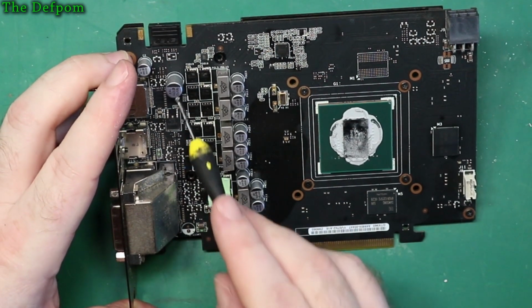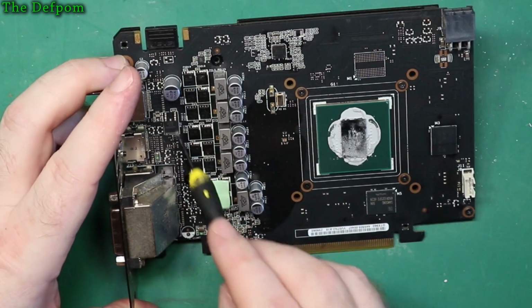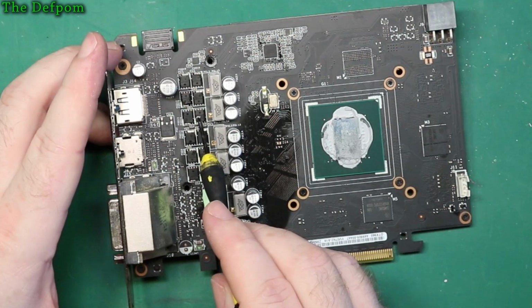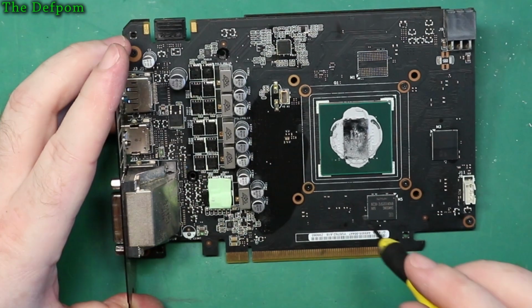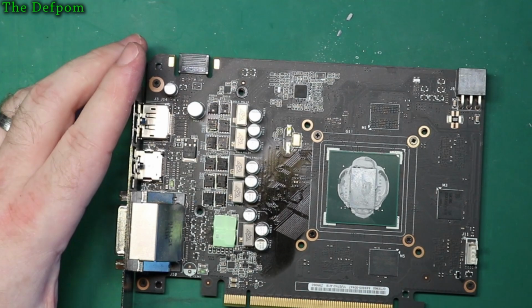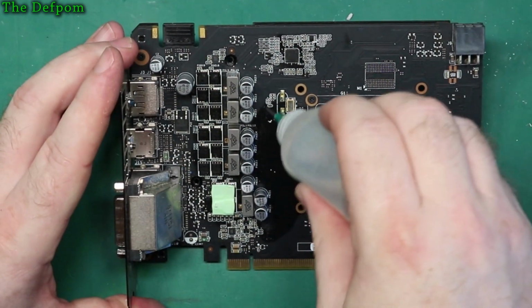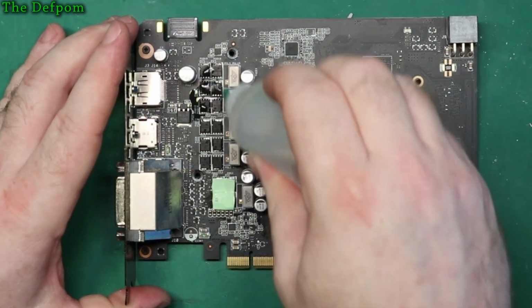And that's a 270, 16 volt, which looks like it may be gone as well because there's some oily residue around this chip here. Or is that a MOSFET? That's a MOSFET. Something's gone. Don't know where. So we'll give it a clean up and try and get rid of this residue, because this is quite corrosive and it can actually cause all kinds of problems.